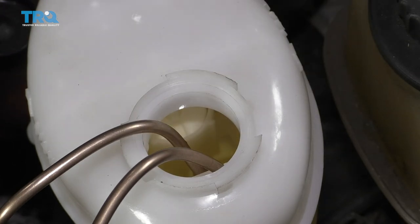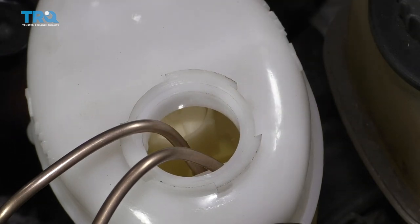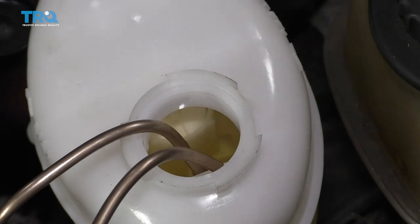Let's give that a try — go ahead and push it down. I can still see some air bubbles, that's great. Here we go again. We got much less air on that one — that's great news. Keep an eye on the brake fluid level because you don't want it to drop any lower than the lines inside the master cylinder. Keep repeating this process until we don't see any more air.